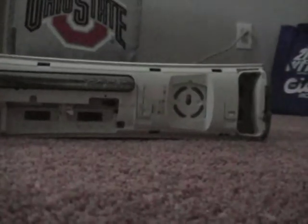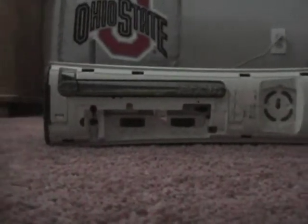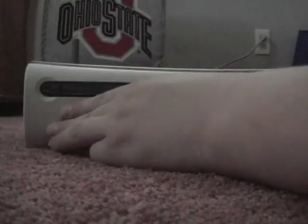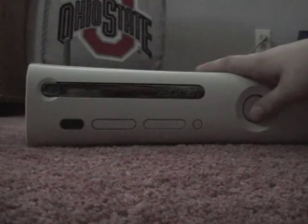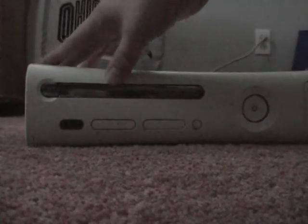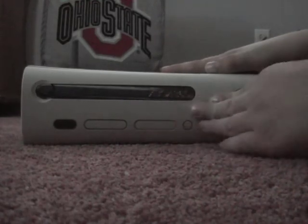That's your faceplate right here. So that's what you got to do, and you got all your bare insides. Now I'm going to show you how to put it back on — really easy. What you got to do, just see these little black holes, they're all over around here, and then you got to line them up and get those pegs in there. You got to press them against the pegs, then go ahead and line them up, push forward, make sure it all clicks. Move your fingers all around here, press around, make sure your power button works, sync button, disc tray. Push over here so don't get caught and block the disc tray because then your games won't be able to read. If for some reason it doesn't work, then you can just go ahead and take it off and try to reposition it.